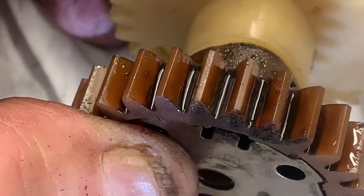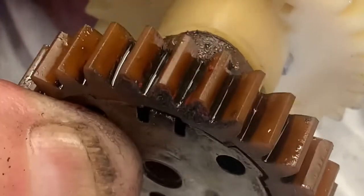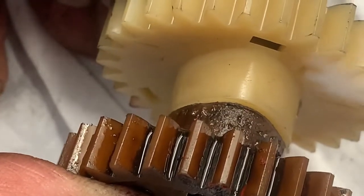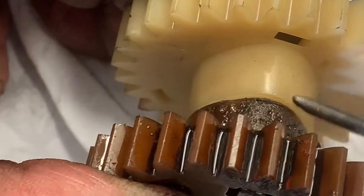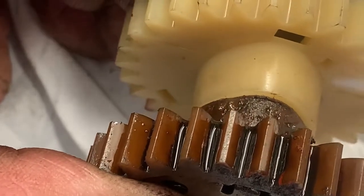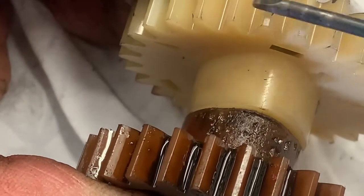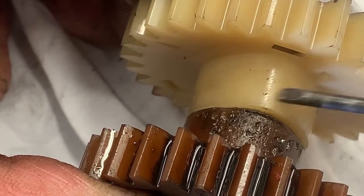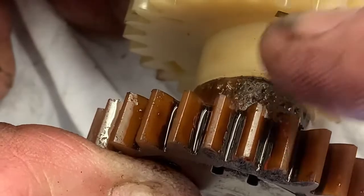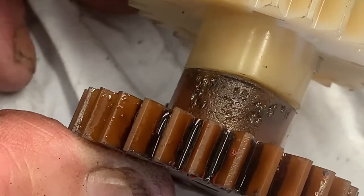What causes this is beyond me, because it's probably a combination of incorrect fuel mix, incorrect just about anything. Heat is probably the most common cause of this, but right here, I mean, it's thousandths of an inch, but if you're not lifting a valve open as far as it should, plus the top of the camshaft has more of a mountain or a hill, and the profile of the cam is just worn away on the old one. Was the engine running? Absolutely, it was running, but it lacked power and it lacked RPMs.